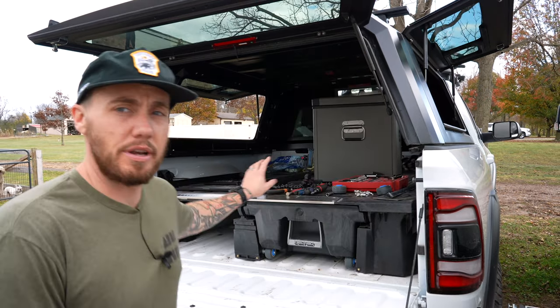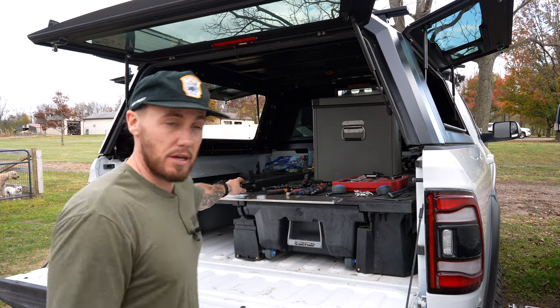After getting all that off, I'm going to put some waterproof tape underneath the holes and then put some black silicone in the holes I created the first time I installed this. That way the tape will hold the silicone from coming through, which should alleviate any water penetration. I might put a little piece of tape on top as well. All of it is going to be situated underneath the fridge slide itself, so I'm not super concerned.